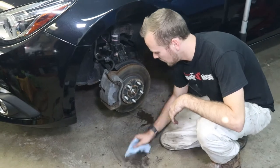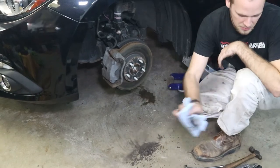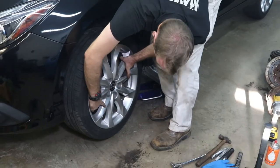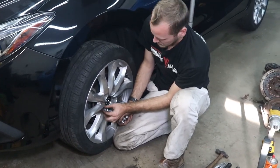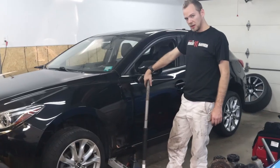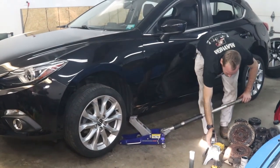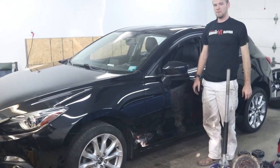Real quick before finishing, wipe away any exhaust debris and corrosion. Put the tire back on straight, line it up on the studs, grab the lug nuts, and tighten them in a star pattern — just like every manual tells you. Jack the car up off the jack stand, lower it to the ground, and you're ready to drive away. Thanks for watching.